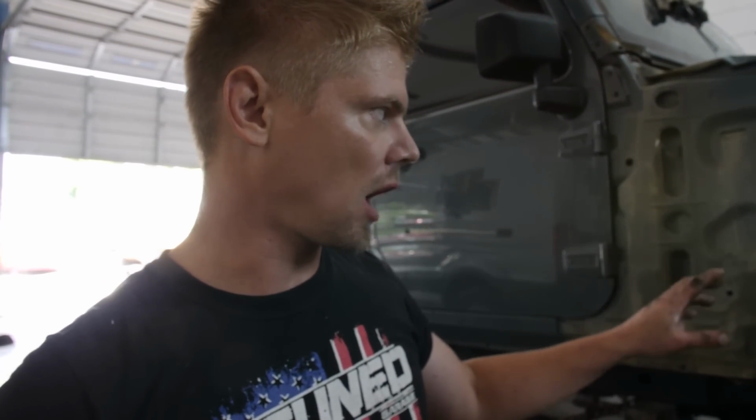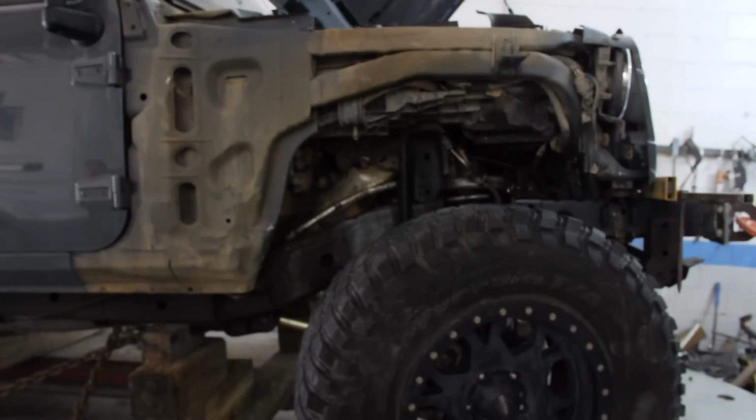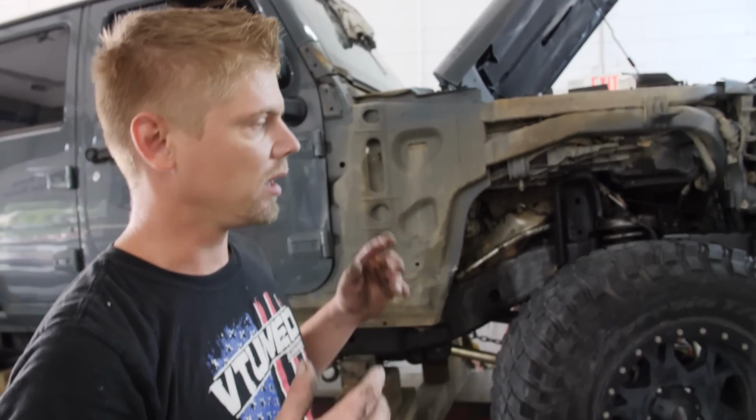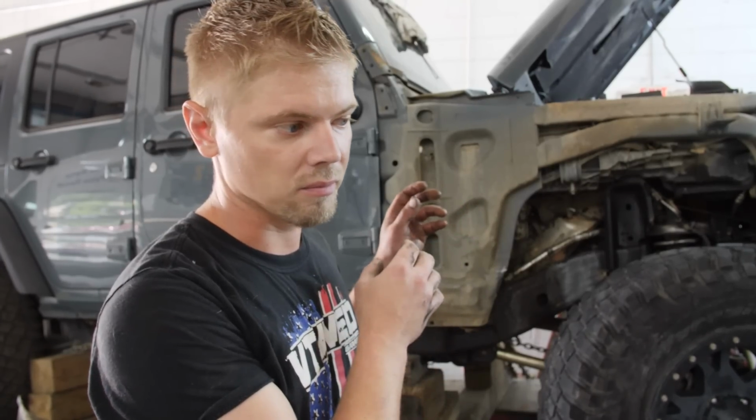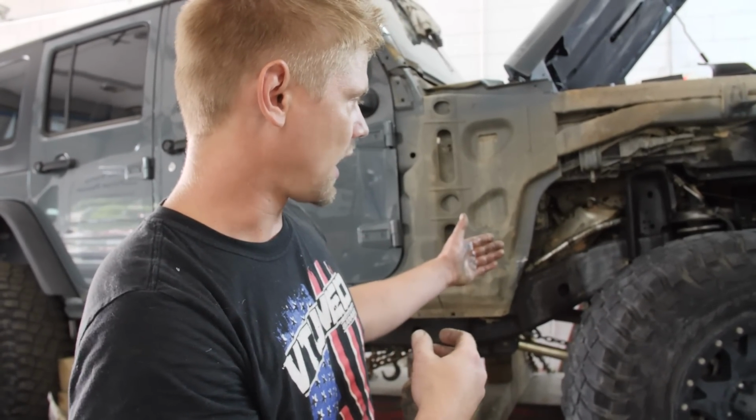That is the only real thing stopping us from just rigging it up. We could rig it up, like the man said, it's a Woods toy. He's not worried about it. He just wants it to drive straight. But that engine mount being how it is, that's going to force us into actually fixing this frame the right way. Otherwise, you're not gonna get the mount on there.